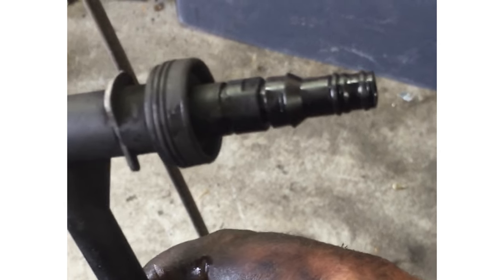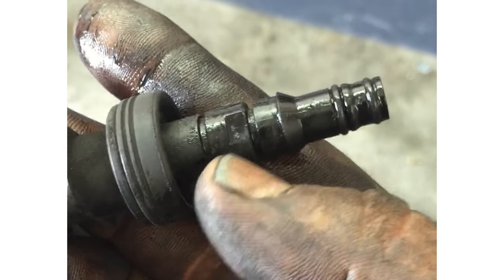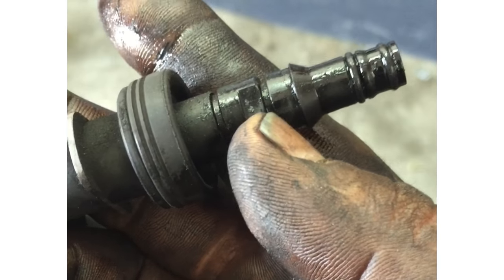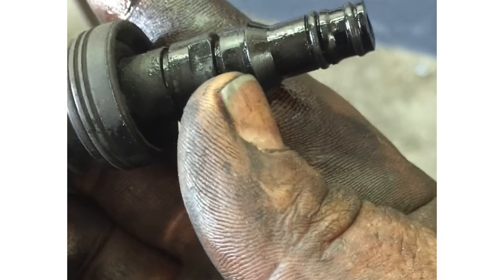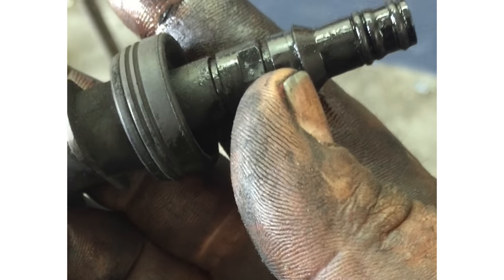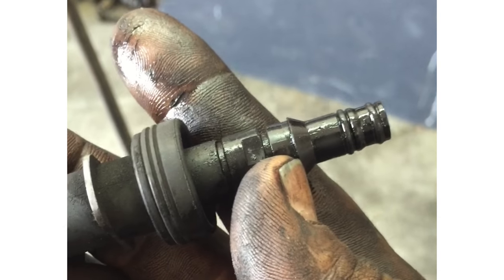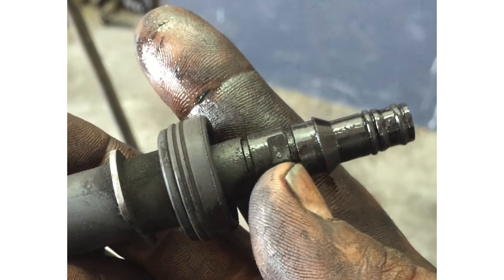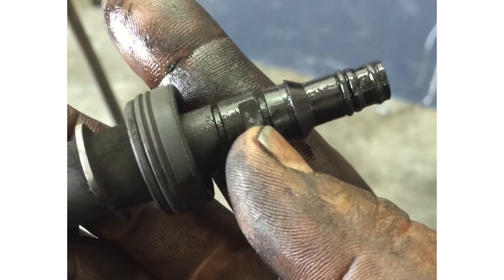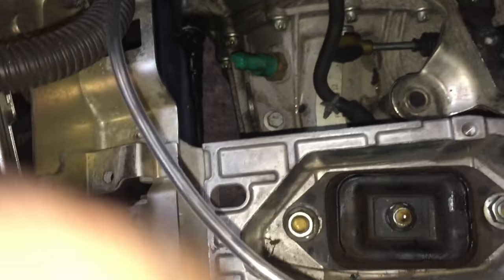Just to understand where the second position is — this is the slave cylinder, it's inside. This is where the hose goes, and the clip usually holds here. When we press it and bring it back, it comes to the second position right here and then we can bleed it. After we finish pumping, we have to press it down and at the same time push it to the second position to close the bleeder. That's how it works.